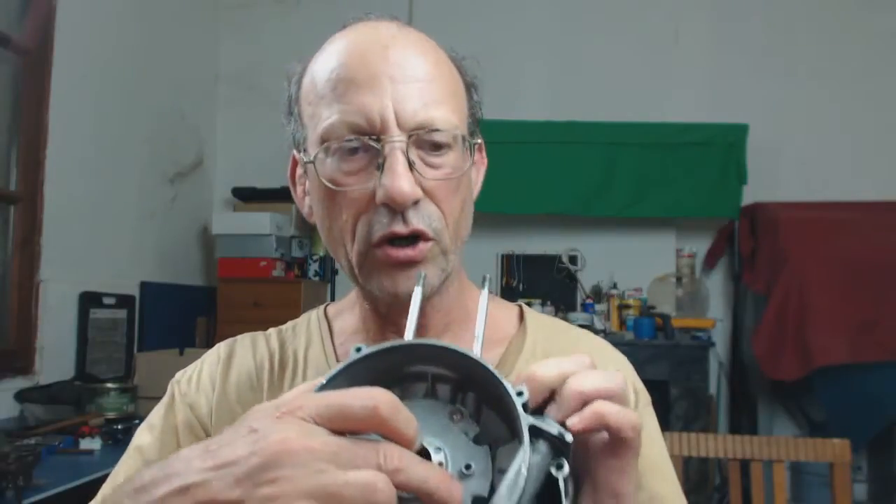So I'm going to drill them out rather than buy more torx bits. The project is for this AM6 — I did an earlier video explaining how you can drill clearance holes in the back plate so you can get the crankcase studs out, then split the engine while leaving the generator back plate in place. That means you can get it flat onto a pedestal drill, and for this job you really want it on a pedestal drill. The screws are here and here, and they're known to cause lots of problems in the AM6 community.